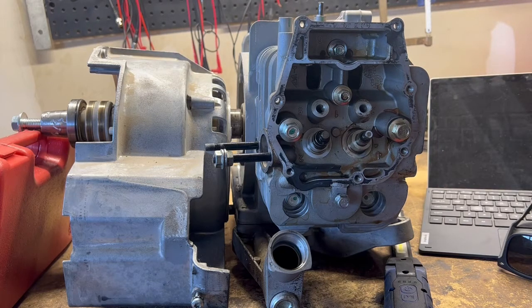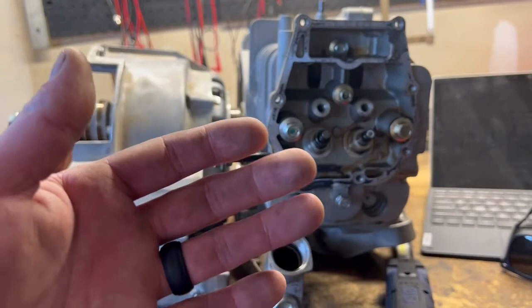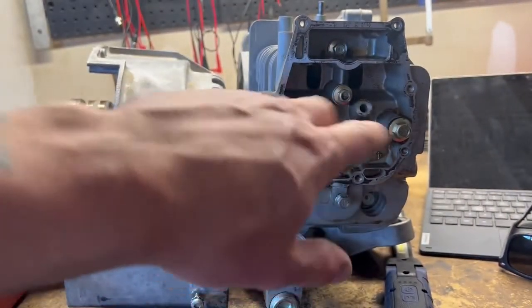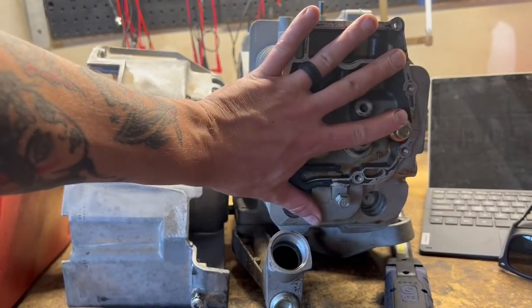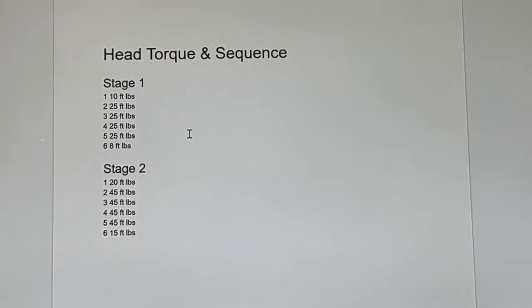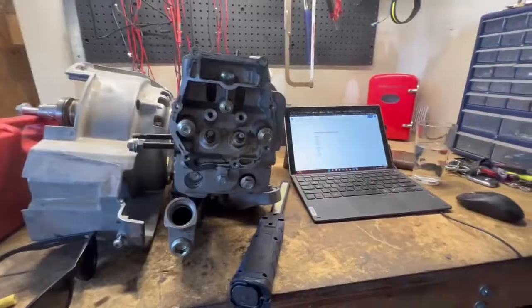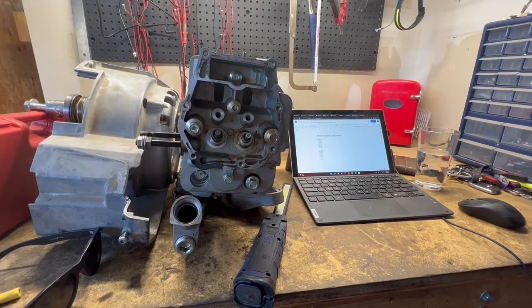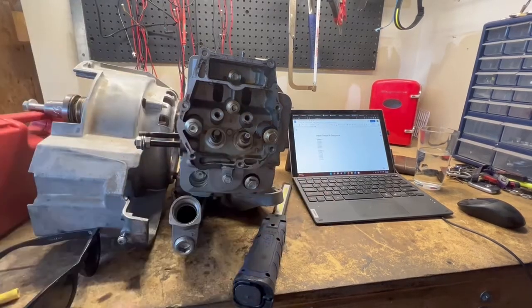So let me write down all of our numbers that we got, make a list, and then we'll go over probably what you should do in your staging. Because you never torque a head just at one go — you wouldn't just tighten one bolt down to whatever it is and then tighten your next one down. You want to stage your torquing for heads so that the head seats as evenly as possible. So here's our list — feel free to pause the video if this is just the information you're looking for. Based off my experience doing heads and the information we just gathered from untorquing them, this is the way I would stage and torque this head for reinstall. Here's stage one — when you go to install your head, you go through that sequence stage one: one, two, three, four, five, six. Then stage two, you'd start all over again for your final torque. And that should do you just fine.